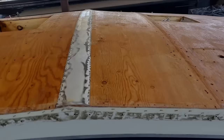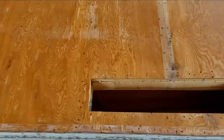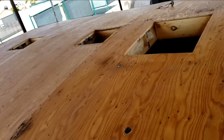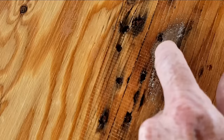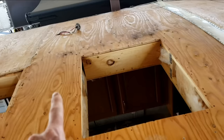Okay, so here we are — we're looking really good. The old rubber is basically off the roof. Obviously we have to cut it off the front there. We'll prep the deck. There's really not too much prepping to do because it came up really nicely in this Arizona heat. We'll ease this splintering just a little bit, but the deck itself is in great shape. The only somewhat watery-looking spots are going to be right about there — the roof was probably torn right about there. And maybe a little bit at that skylight right there.